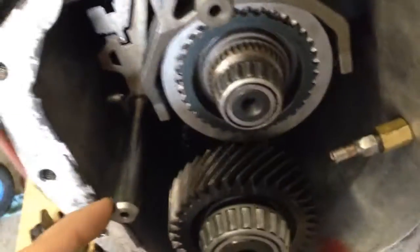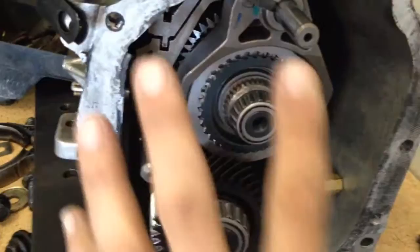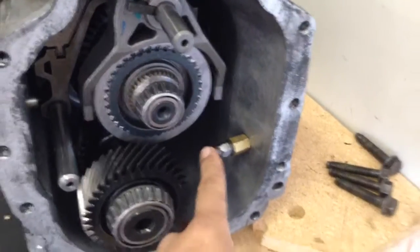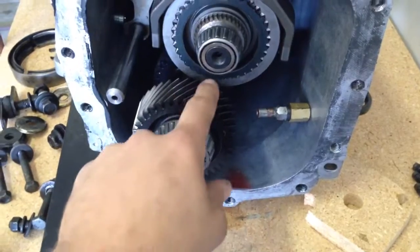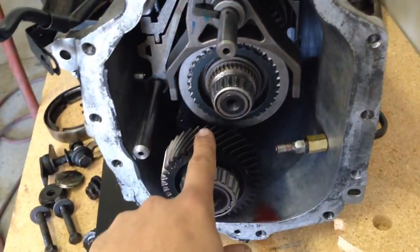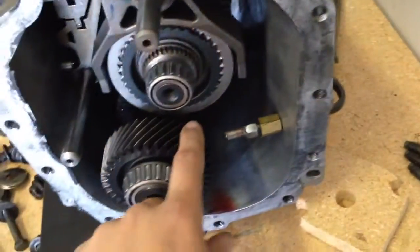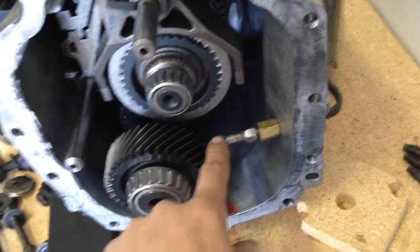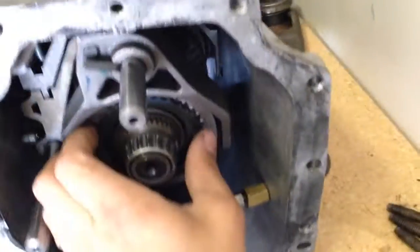Be careful — these shift forks here pilot into the front plate, so lubricate those and slide them in carefully. You won't find this in any stock setup — this is my custom ATF pump for drag racing. When I run hard, all the fluid sloshes to the back. I've already burned up a headset, cluster, and input shaft. This pump constantly sprays fluid when drag racing — I have a switch so I only run it on the strip, not street driving.